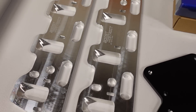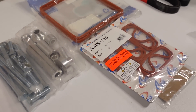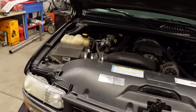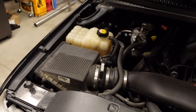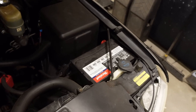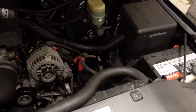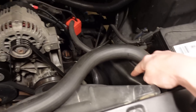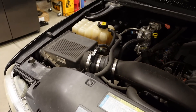There are a few things I'll need to get on my own to finish the installation. The first is the fuel pressure regulator and a way to connect the fuel lines to the supercharger. The next big one is the air intake system — some filter and an intake tube. The LSA blower mounts the throttle body off to the driver's side, but on the Silverado the air filter is on the passenger's side. I'd like to try mounting the filter on the driver's side, which would require relocating the battery using a Duramax battery tray and rerunning some battery cables.